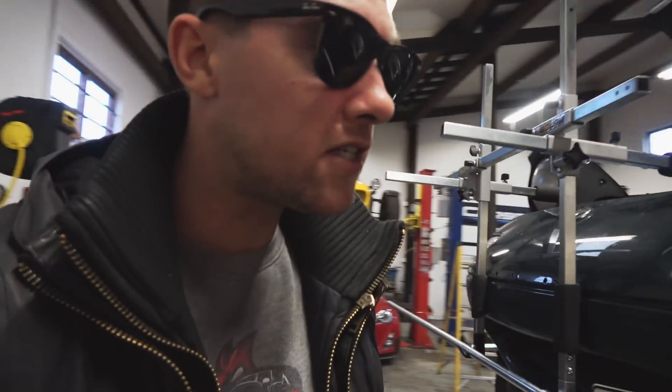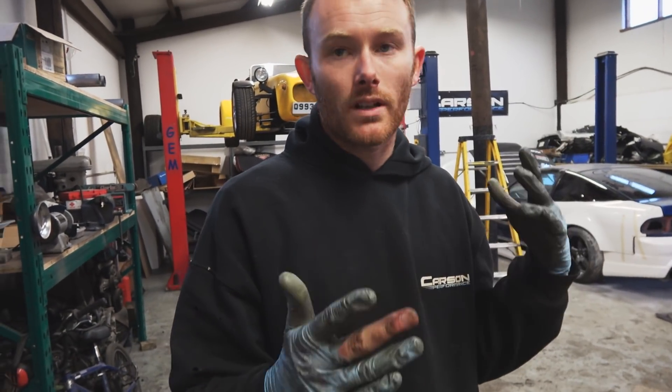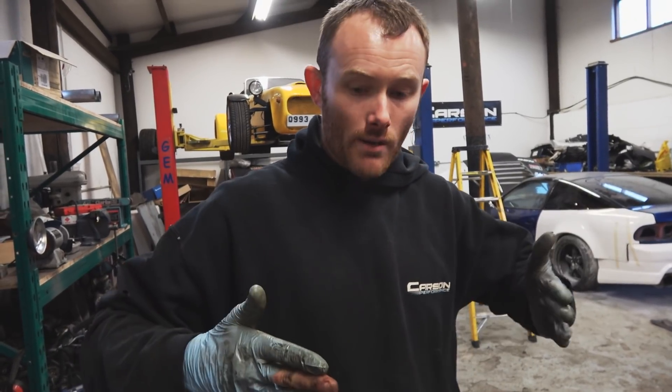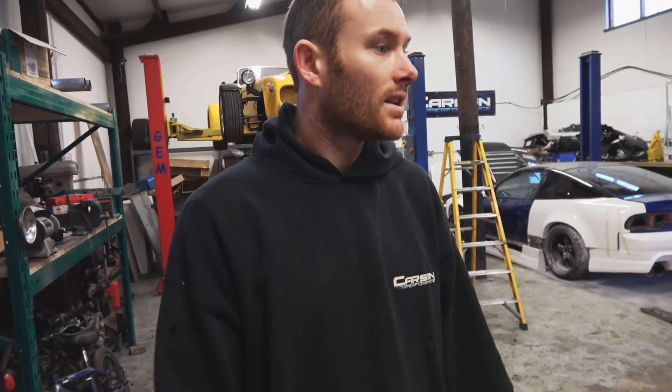Scousey is adjusting the camber from the lower arm and Mikey's just checking the measurements — one and a half degrees negative camber on the front. The measurement is 67 and 68 — that's one mil of toe out on this wheel, all good to go. So the rear camber we've had to run negative two and a half degrees each side — we wanted it a bit less, more like one to one and a half, but we couldn't get that with the adjustable arms available. Rear toe is one millimetre toe-in, fronts are one and a half degrees negative camber and one mil toe-out each side. A bit more camber than we wanted at the back but it's all equal and square so it should drive really nicely.